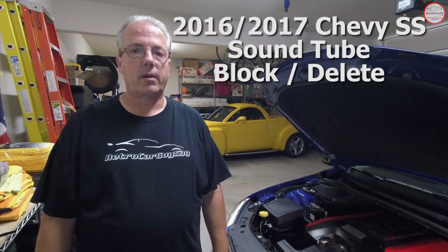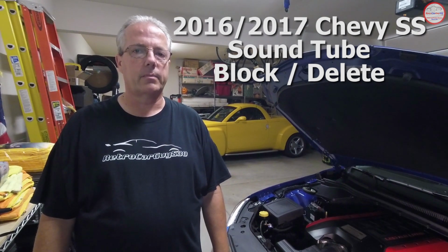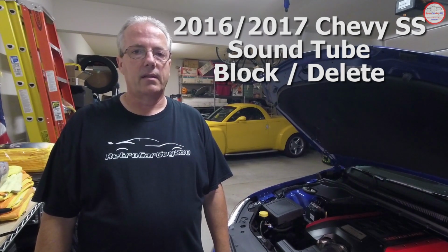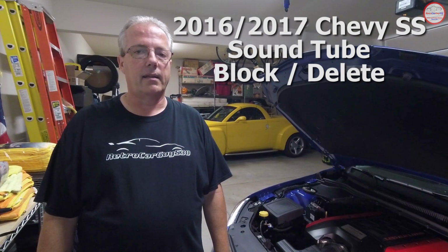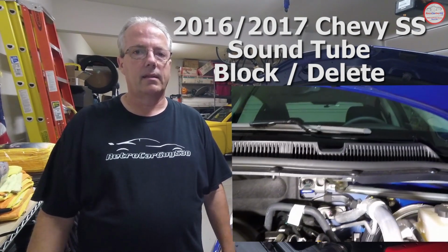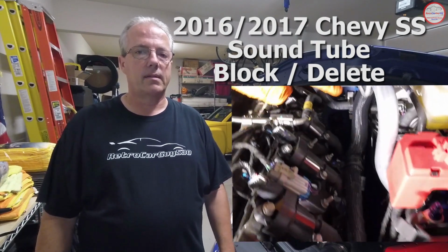In today's video I'm going to alter the sound characteristics of my 2017 Chevrolet SS Sedan just a little bit. I'm going to modify the kazoo tube on my 17 SS Sedan by blocking it at the air inlet. And you're asking, well, what's a kazoo tube? Well, that's the name that's been given to this particular tube, which brings engine noise into the passenger compartment.